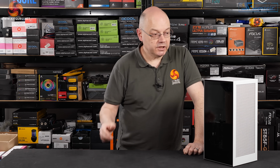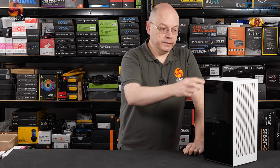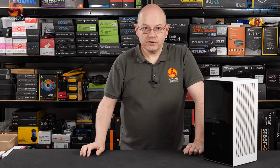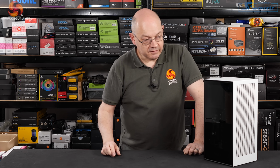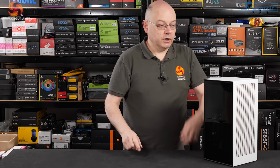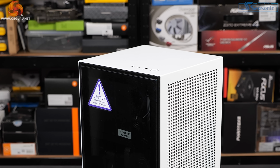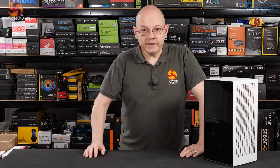It's also worth mentioning that in this particular build, my Gigabyte B450i motherboard does not support USB Type-C. Many ITX boards have limitations. After all, the manufacturers can only put so many ports and connectors into the limited space that is available. In this instance, Type-C is not one of the options. So if I take the Type-C out of the equation, I'm left with a single USB Type-A. That's not so good. A couple of ports would be better. Anyway, we're now ready for action.